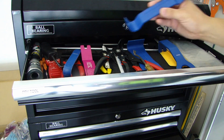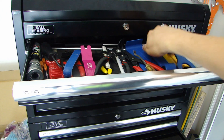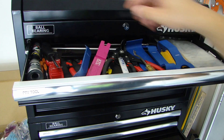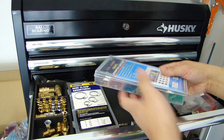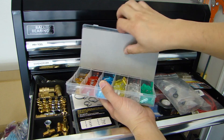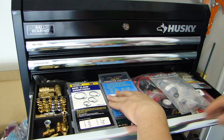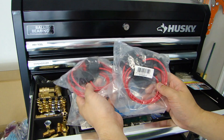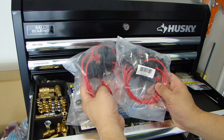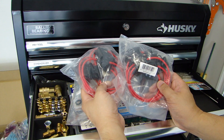Let's move over to my tool chest. Here I have some pry tools — a must if you're going to be doing any type of stereo install, because you don't want to scratch the panels in your vehicle. I have different sizes of pry tools. Here I also have some additional ATO fuses with different amp ratings. Over here, these are inline fuses. If you're going to be adding any accessories to a vehicle and it requires you to bring in 12 volts from the battery, you definitely want to fuse that wire so you don't risk any electrical shorts.